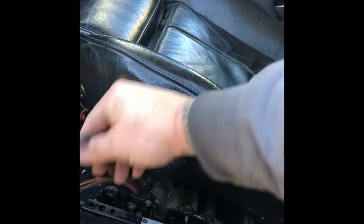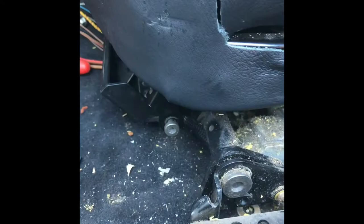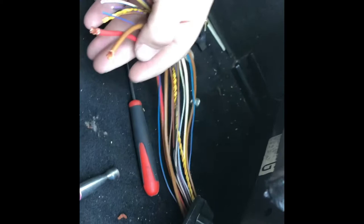Here is the interior of a BMW 740i. The seat controls were cut out by somebody and are no longer working. The issue I'm having is I can only reach the front bolts of the seat and am unable to reach the rears. So in order to have ease of access, I've gone and removed these little bolts down here, which is going to allow you to tilt the seat back. You can also see here where I tapped into the main harness and was unsuccessful with that.